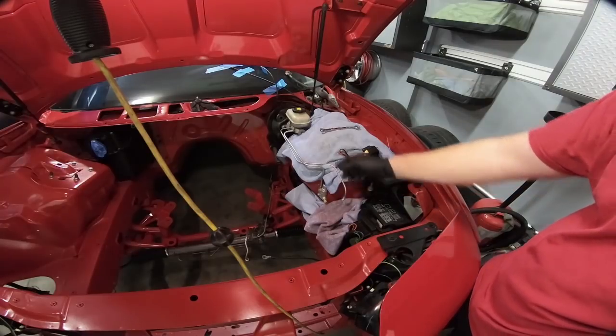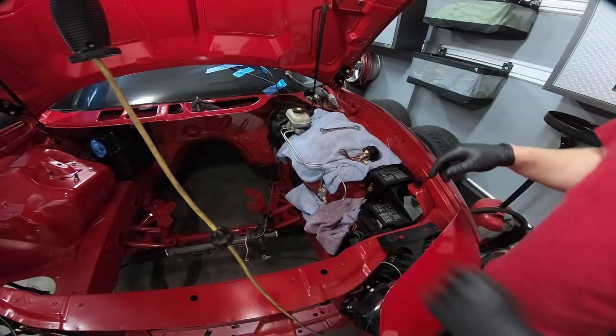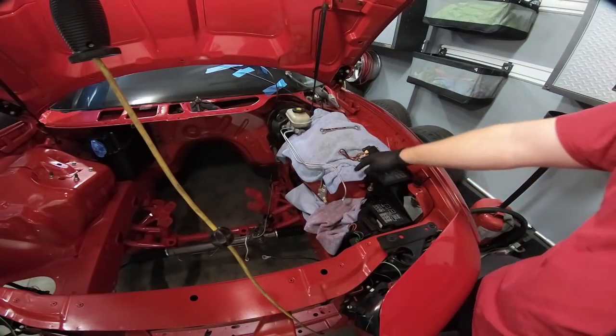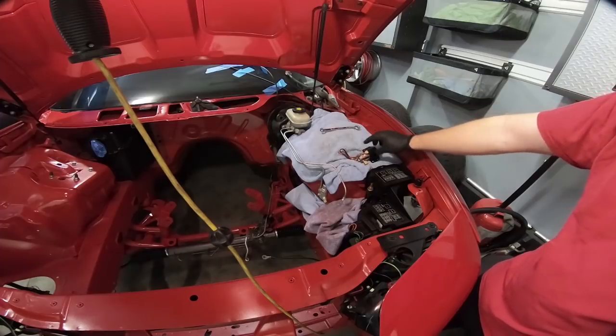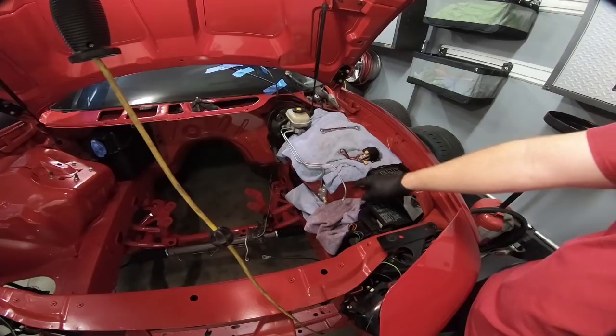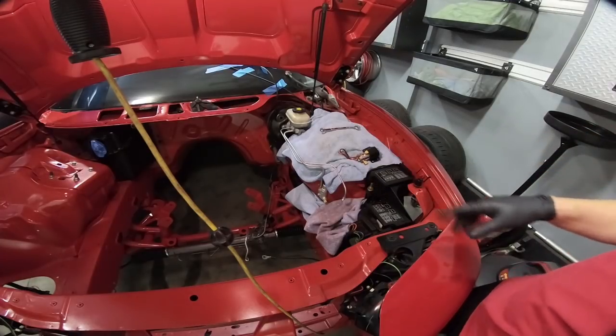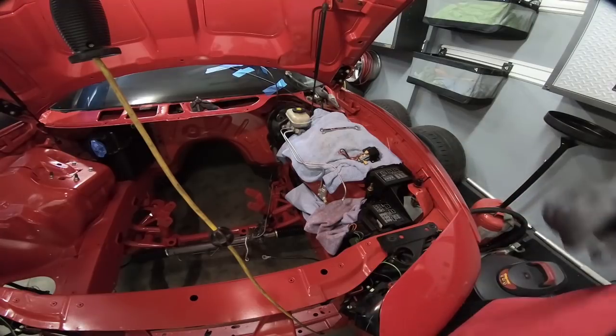Now that we have that line moved to the bottom side, you'll notice some brake fluid spilled out, so try to catch that if possible. We need to figure out our placement for the actual solenoid for the line lock. It's going to be somewhere in this area — we're going to hold it up and try to partially thread the line in to see where we need it, then unthread the line, mount it, and get everything tightened up.